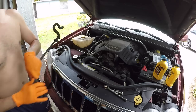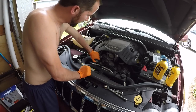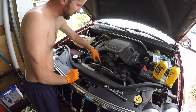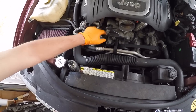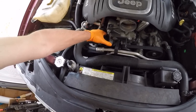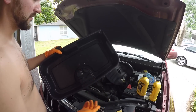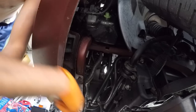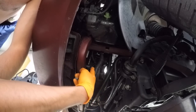That's your throttle body. I have my upper hose from the radiator here so I'm going to loosen this clamp. My thermostat is right in here behind this hose, behind the body right here. I'm going to go ahead and loosen that, take the thermostat out, and put a drain pan under the engine for any coolant that might come out. Right here is the coolant drain cap — I'm going to go ahead and loosen that cap and drain the fluid; you just twist the little tap right there and it opens up.